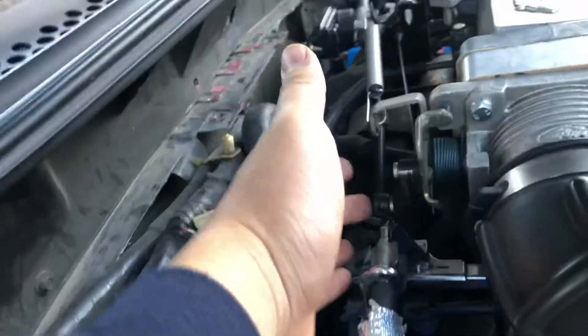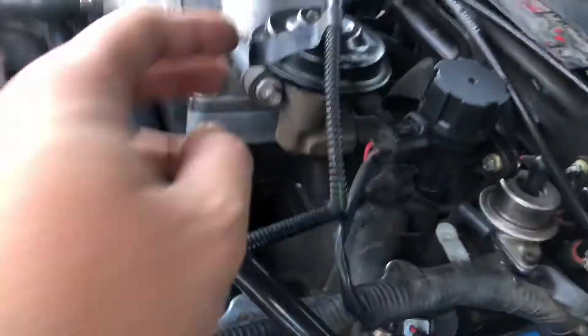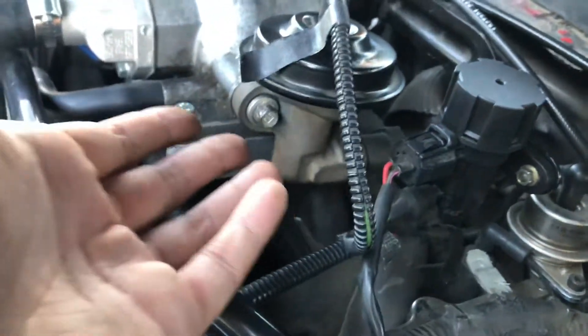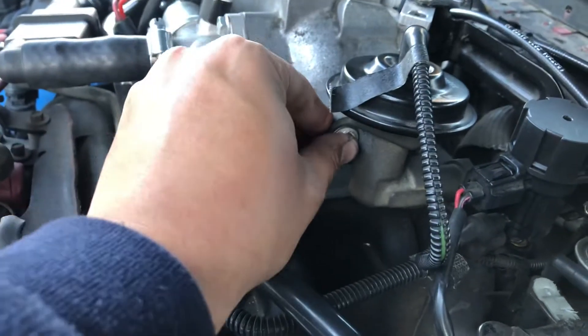To be on the safe side, I got a one-inch plenum spacer so it'll clear this space. Installing it is pretty straightforward, so I'm not making a full install video. The hardest part about putting this together is getting the EGR valve to line up — since it's obviously higher now, you need to kind of force it up and get a bolt in on one side.